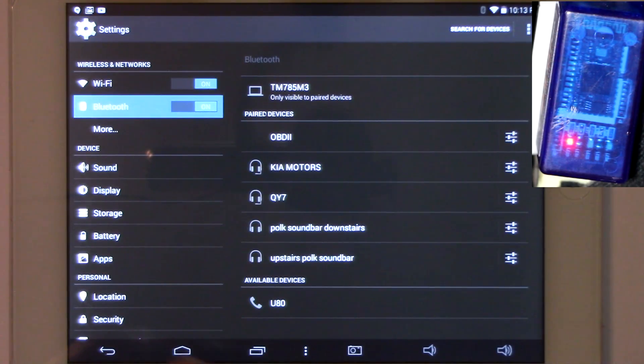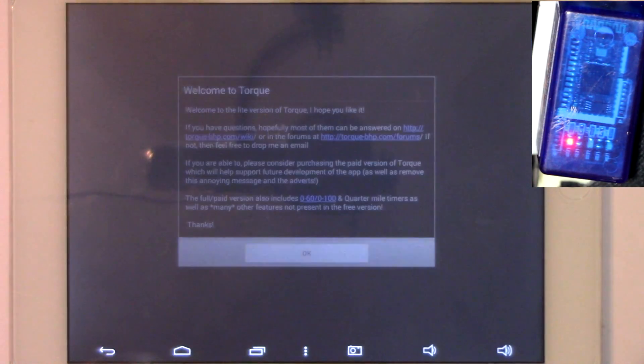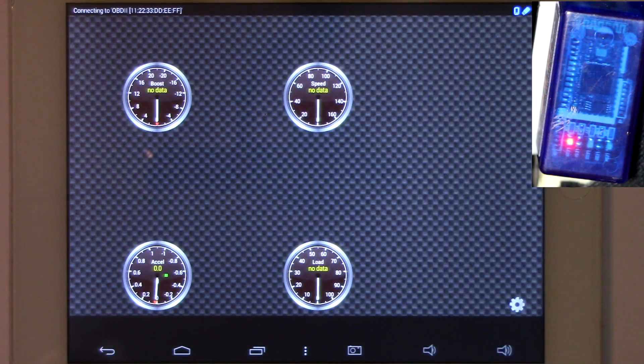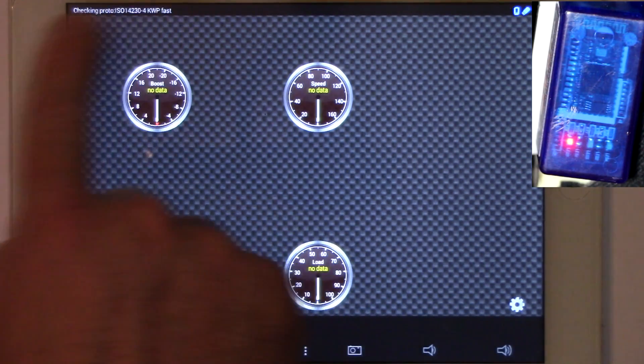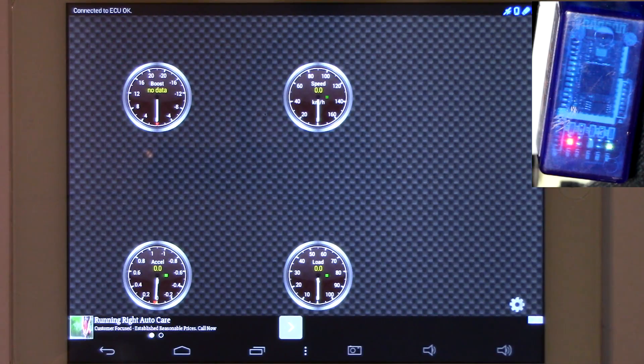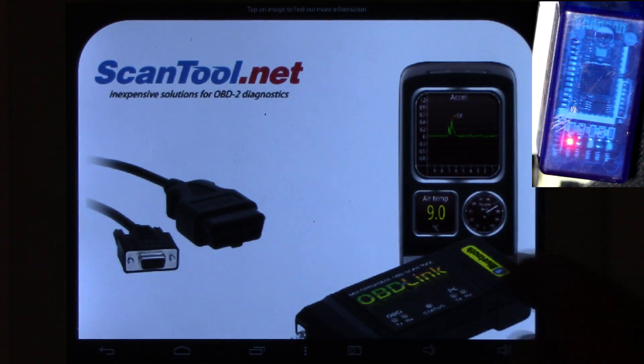I'm going to minimize settings and go to my Torque Light app. It gives you the welcome to Torque screen — hit OK. You should see up here where it's connecting to your actual OBD2. Now it says connected to ECU, which tells me that it's actually connected. Let's go look at the settings — this little gear icon. Let's see what OBD adapter information says — well, it's trying to sell you one, so I don't care about that.